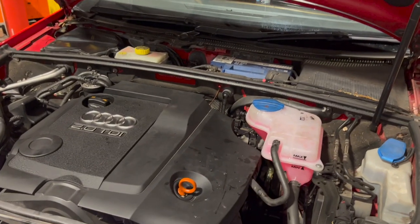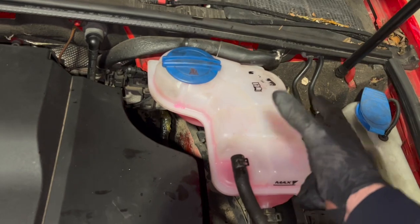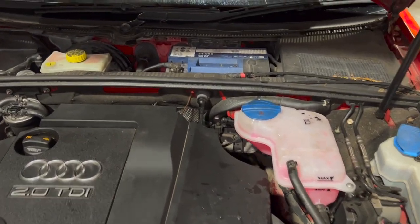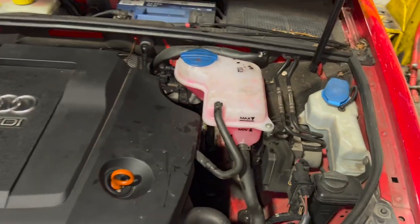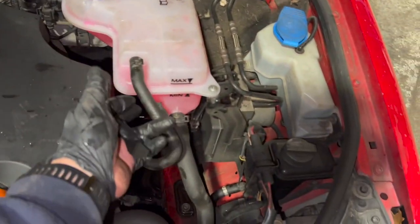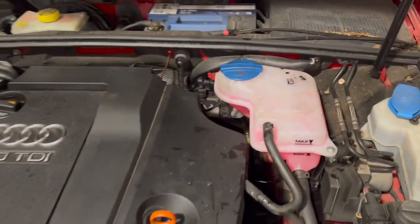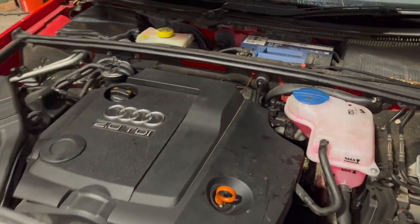So that's the cooling system all bled up now - as you can see, quite a straightforward job. Didn't take too long. Sometimes it does help to just have the bottle a little bit higher or just keep it topped right up to the top, just helps it come through. Some cars, if it's really tight to get off and you're struggling, you can just bleed it up by leaving the cap off and you'll get most of the air out that way. What I'm going to do now is just run it fully up to temperature, keep an eye on it, check my pipes make sure they're not leaking, and then check the level when it's cold in the morning. Hope the video helped - if it did, give it a quick thumbs up and subscribe to the channel. Thanks for watching, see you next time, don't forget to check out any of the other videos.